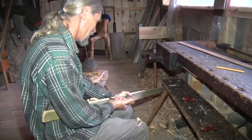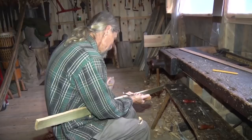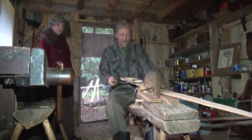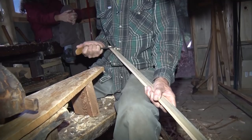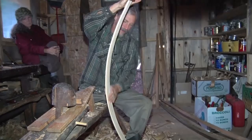You could even fix your boat if you happen to be in a bark boat — pull off on the riverbank and find all the materials you need to make all the parts you need. Get the bottom flat and bring the top down to it. Doing a bevel so when you pound the ribs in it won't just split off the edge, and makes it a little bit easier when you're dragging stuff around in the canoe.